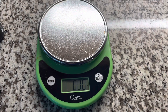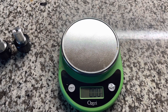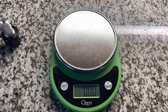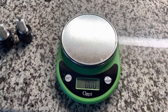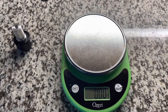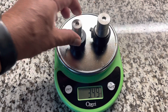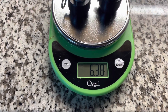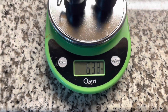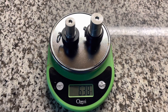Anytime you add some weight to the front wheel, you're adding unsprung mass. That's going to create some inertia and might affect the handling, especially as you get into corners. So this is something you might or might not want to do. The two axle sliders with the base and the puck weigh 6.38 ounces, so that's something to keep in mind.